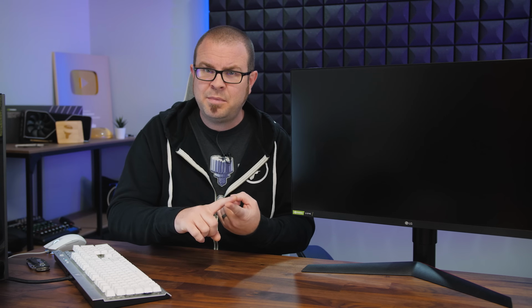The other part of your gaming monitor that I would suggest you double check before making a purchase decision, if you're not going to be using one of the monitors that I'm suggesting today, is to look at the panel technology. TN or twisted nematic panels are pretty common. They can achieve high refresh rates, but they do not do as well in terms of color reproduction, so I would recommend staying away from those if you can. You're going to have a better experience both for gaming as well as media playback, watching movies and videos, or especially if you do any content creation type activities, if you go for a better panel, typically IPS or VA. Those are the panel technologies that give better color depth while also not sacrificing in terms of refresh rate and also not costing ridiculous amounts of money.